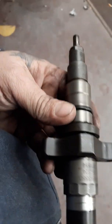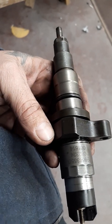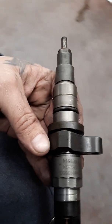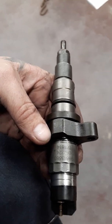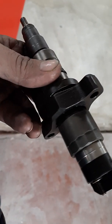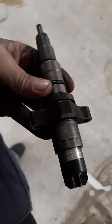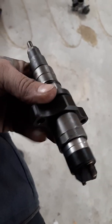If you watch with a pressure gauge or scan tool while cranking on a no-start, you'll probably be seeing around 600 PSI — that means at least one injector is returning too much. I've tried replacing one injector at a time, but as soon as you replace one the next one goes bad, sometimes the same day. It's pointless — you have to do them all at the same time. If you've got 200,000 miles or are getting close, start saving your money and buy all the injectors ahead of time and put them in.